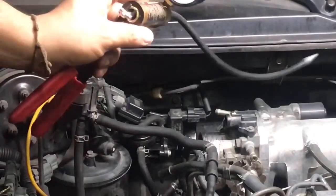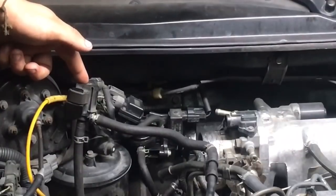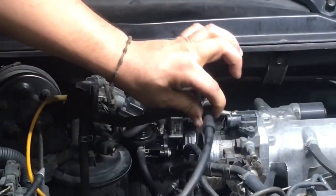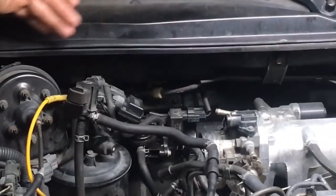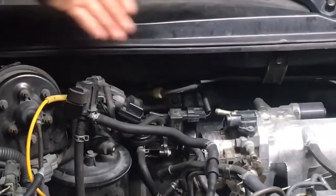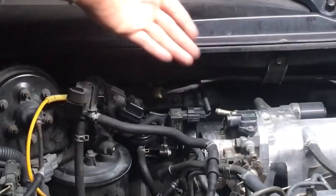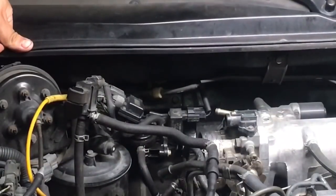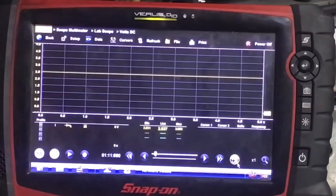So what I used was a little pump. By turning on the purge — because this is normally closed — we can hook up our pump to connect to the canister side. The vent solenoid is an open system, so once we turn on the vent solenoid it closes off so we're not getting any air out. The bypass valve is a closed system, but once it's turned on it opens up so we can flow through everything. I'm going to show you right now using my Snap-On, and we're going to look at the voltage.